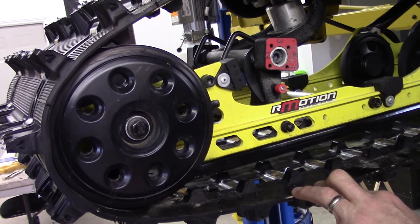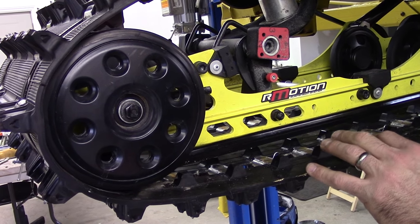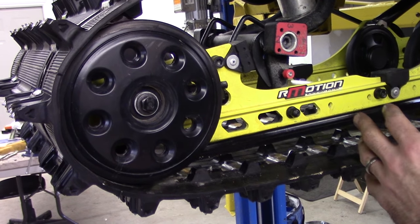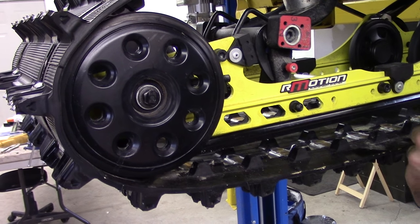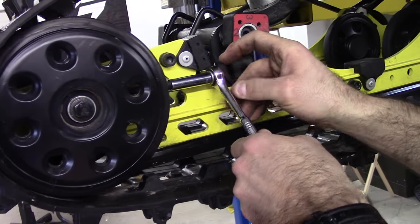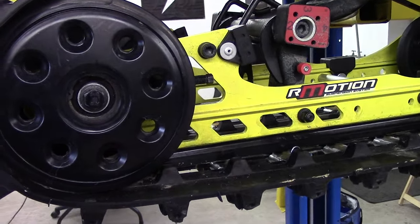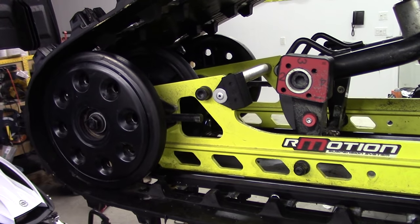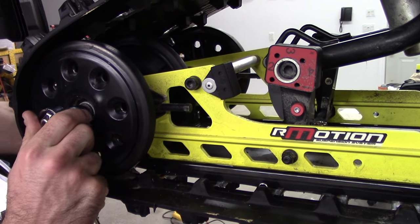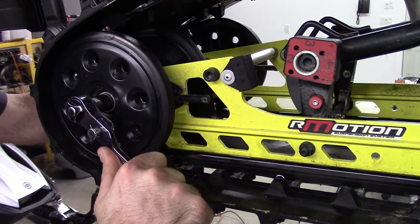Your final step is to re-tighten the track. One thing to remember is that when you tighten up the track the slide is going to have to work itself in, so you don't want it too tight — that will create a lot of extra heat and burn through your slide. But if it's too sloppy the cogs are going to jump the track. Tighten this up equally on both sides and you may have to do a second tightening after the first hour or two of sled use. For the last part of the install, sink down the 16mm sockets to tighten up the rear axle, then throw the dust caps on and that's about it.